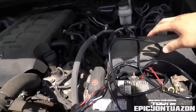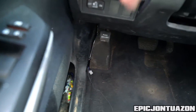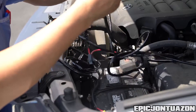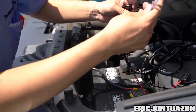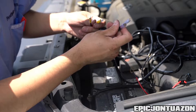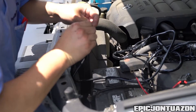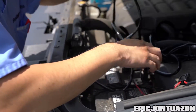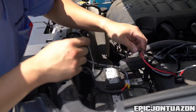We have our wiring harness running through the firewall. In the engine bay we have a relay, a positive and negative going to the battery terminal, and a fuse in between. We have the line going into the car and then a positive and negative going to the light bar. I'm going to plug this in — red to red and black to black. That's secured. Then we're going to plug the terminals into the battery and then plug it into the rocker switch and see if it turns on.